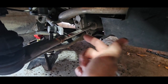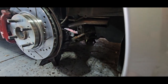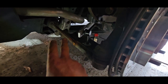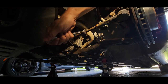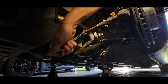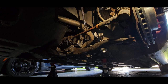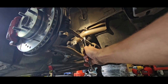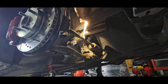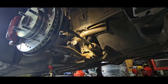So if we want to straighten it back out, we're going to have to bring the wheels to the left to try and straighten out the steering wheel itself. I'm going to be rotating this one two times around and bringing it in — putting the threads into the knuckle here — so it pulls this wheel inwards. On the driver side, I'm going to have to extend this out just a little bit, so I'm going to do two turns. That side gets unthreaded two rotations, and then let's go ahead and tighten the nut back up on both sides.